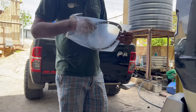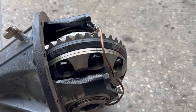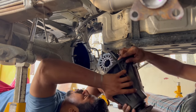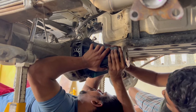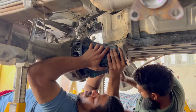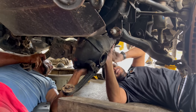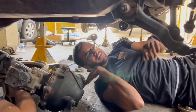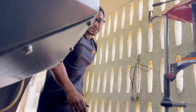We're changing the seal and gasket on the third member. Unfortunately we ran into a minor setback where the seal housing wasn't getting past the differential housing. We checked everything but got on the phone with ARB tech support and they were almost certain we used the wrong size bearing. The bearing we used was literally one millimeter thicker than the OEM bearing, so we had to wait until the next day to purchase the correct bearings. Surprise guests — installing lockers since 2023.